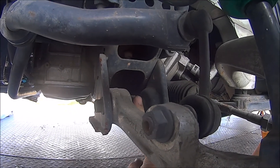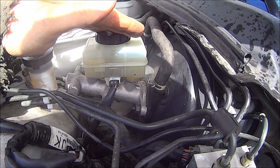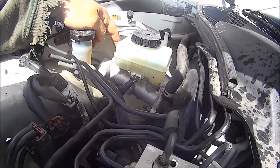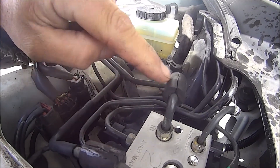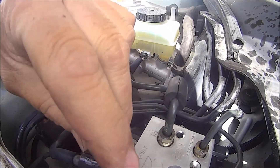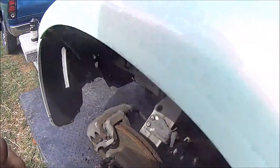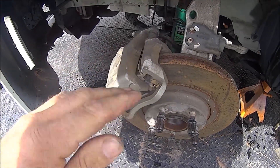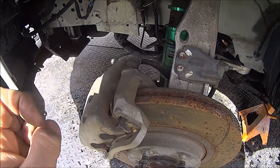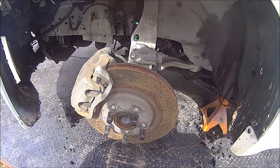We can see it's actually really clear right now. I got a little splatter here, but what I did was let it come out of the master cylinder - just cracked it a little bit when it was getting pumped - and then where it comes into the ABS unit, since we had drained up here, this is where we wanted to make sure we got the air out. I'm hoping I got most of the air out - sometimes you've got to do this a couple times. I did it going in so I got all the air out of these two lines, then I did it coming out, then I did each individual caliper on all four corners. Hopefully that fixes us up.